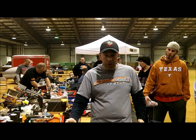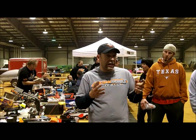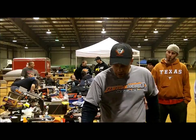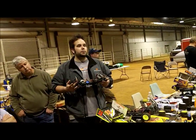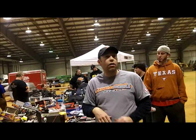I think when you find your car and you have more things towards the center ranges of their settings, it's easier to tune things, so you're not always begging. But this weekend, keeping the hubs forward. Nathan usually on a loose start loves having his hubs forward all the time just to get the grip, and he likes that rear to feel like it's slinging out.